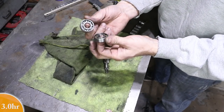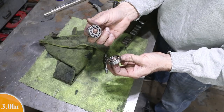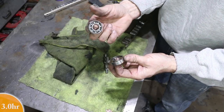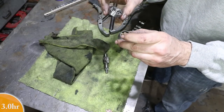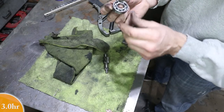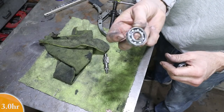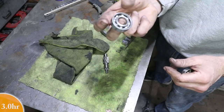The new bearing is identical to the old bearing. This is from McMaster. I can leave the part number in the description below, but this is just a generic bearing. I think this bearing has a number on it, 6202. I can double check the McMaster listing, but I believe that is the one that you need, 6202.